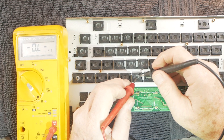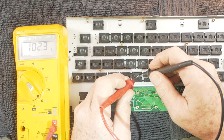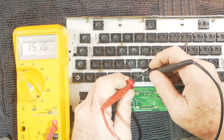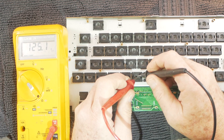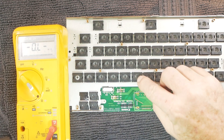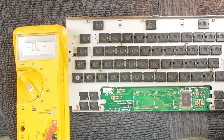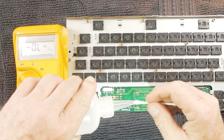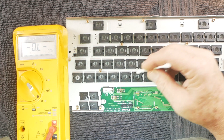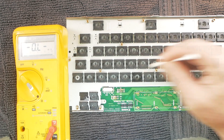I'm reading about 108 ohms — 150, depending on how hard you touch it. The one next to it reads about the same. I'm going to guess that those two little specks of grit on the keypad are the cause of the problem, keeping it from detecting contacts. I'm going to take a little bit of isopropyl alcohol and clean that key cap. I don't want to wipe off any of the black coating, which generally doesn't come off, but just be gentle with it.